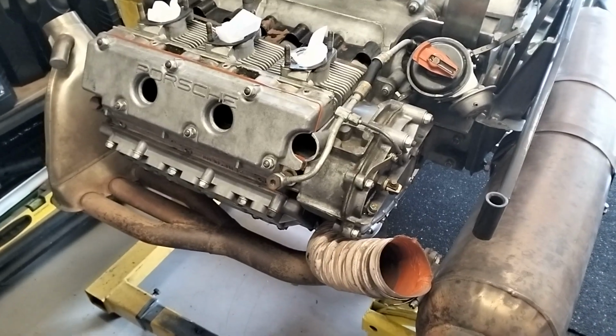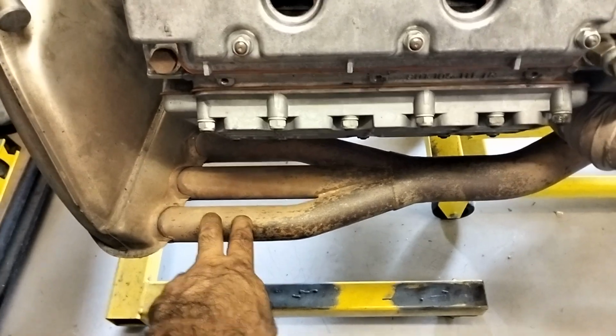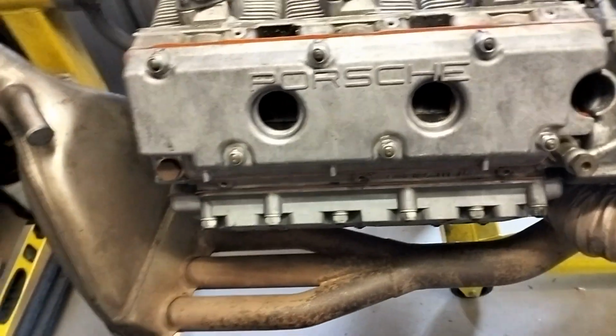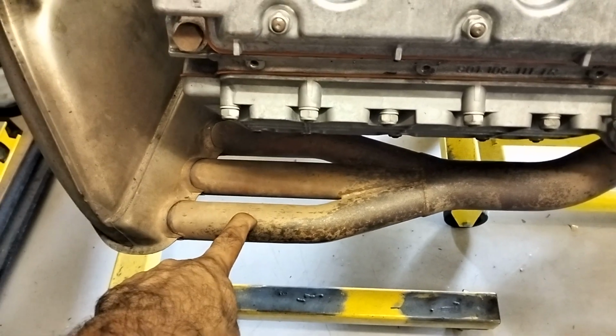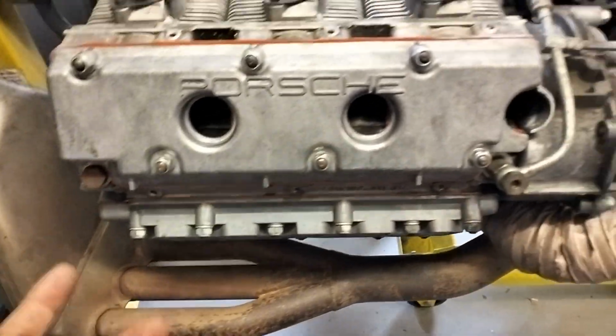It's all subjective. It has been fitted with the SSI heat exchangers, and in my opinion, these are a little bit on the small side when you start to increase capacity. These only have a 1.5 inch primary header size, which I feel is just a tad on the small side. So yeah, 1 5/8 is preferred.